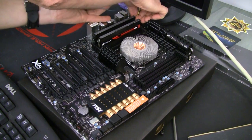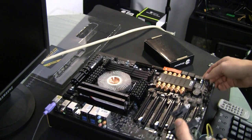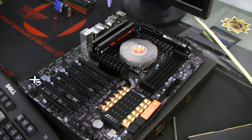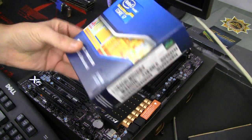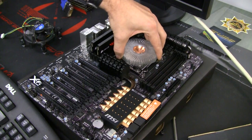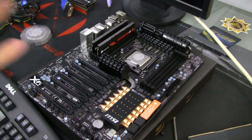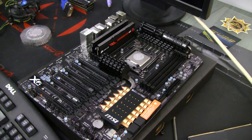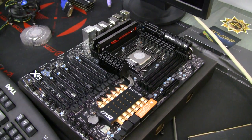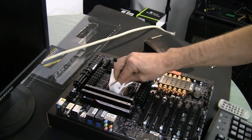I had an improvised heat sink for my CPU because I don't even have an LGA 2011 heat sink at all - the processor I purchased was an OEM version and it doesn't come with one. So I had a modified version of a heat sink from LGA 1156 and it worked fine. During the test, the CPU barely hit 62 degrees - it wasn't in any danger at all - but nevertheless it needs to be removed and cleaned.